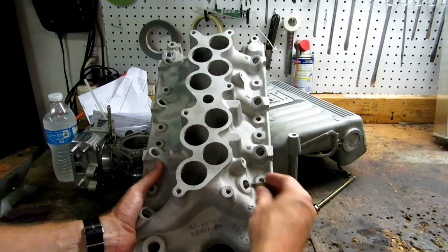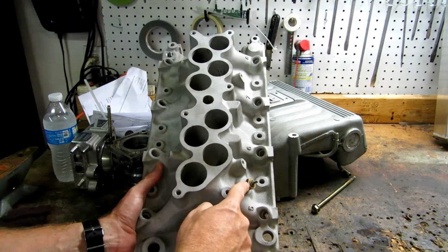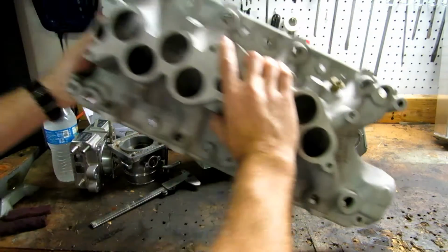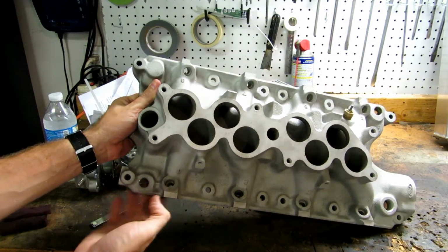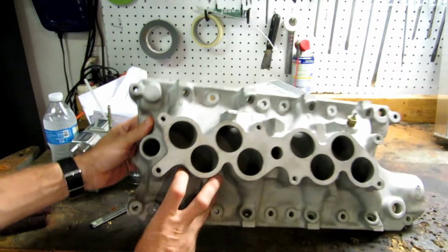This is a coolant sensor, but essentially the same thing. So it'll accept the air intake temperature sensor here, and on the back here we've had this section drilled and tapped for the EGR passage. That way we can keep the EGR stock and keep everything stock.